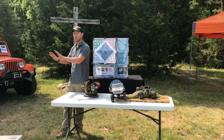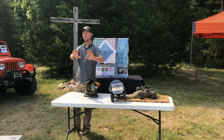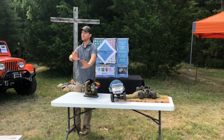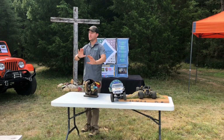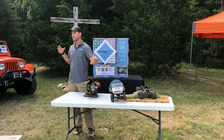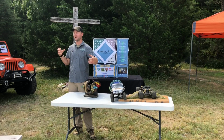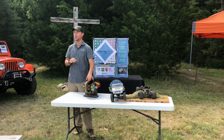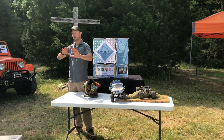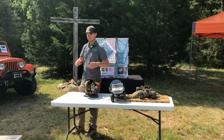And then when we have to stop, take our feet off, shift them over again, right foot brake, left foot clutch, hard on the brake, and then push your clutch in. The reason we use the brake when using our clutch is because that clutch completely disconnects our drivetrain, right? So if you see the guy, he's off-road and he's trying to climb a rock and he makes it about halfway up and stalls, he pushes his clutch in right away and rolls off. That's why we manage that brake. We want to limit that rollback, okay?